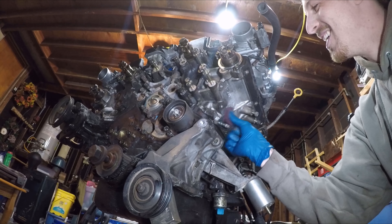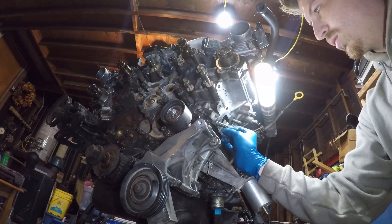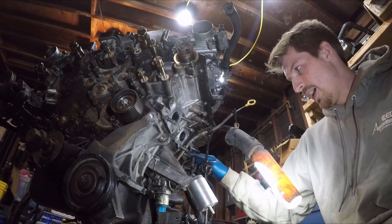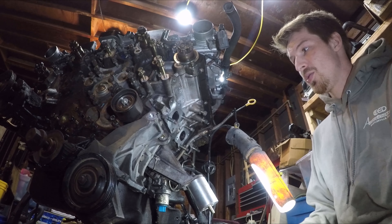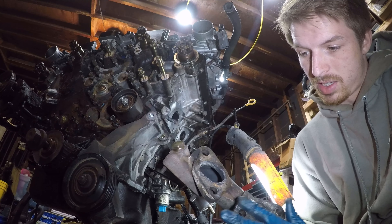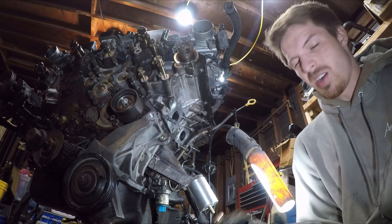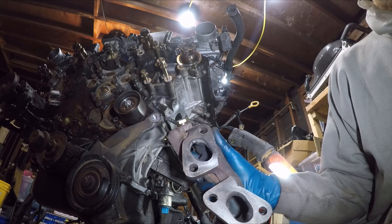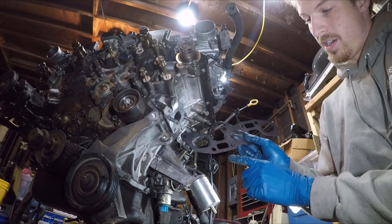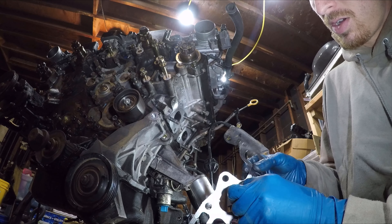I actually need to get the razor blade out because there's just so much going on with this gasket — this one is way worse than the other one. I have all three ports cleaned off pretty well now. I'm going to get the new gasket, cut it, and set it on there. I should also clean the turbo manifold a little bit — it has crap on it too, but I can go pretty hard with the razor blade on that one. So I'll just cut the gasket and put it on there and torque it down. This gasket actually has perforations where it might need to be cut.